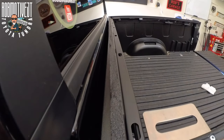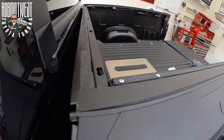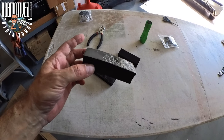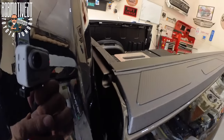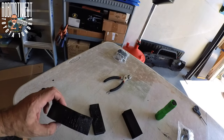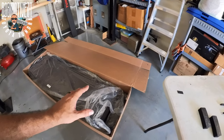I've got the bulkhead seal on, placed as close to the edge as I could per the picture. I did tuck it in underneath the rail in the corners on both sides, again trying to prevent any water intrusion. Full disclosure - I made a mistake. The kit comes with two little blocks and three big blocks. I tried to use the big ones but they didn't fit right - it's because they were the wrong ones. You're supposed to use the shorter rectangular blocks up in the corners for water seal. I was able to pull those out hopefully with minimal damage and the adhesive looks pretty well intact.